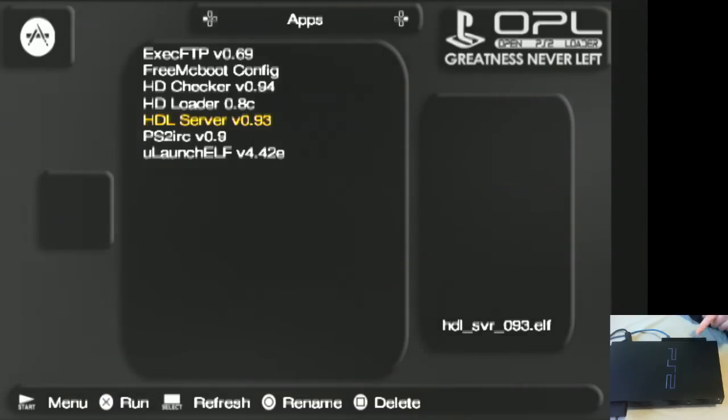You can put your hard drive in your PC to install games using a program called WinHIIP, which I'll also put a link in the description for, but that's got a limit of 256 games. When you get to that amount of games, you can't install any more, but you can install more if you install it over the network using HDL server and HDL Dump.